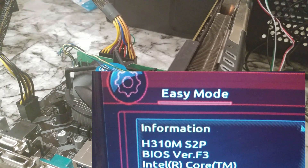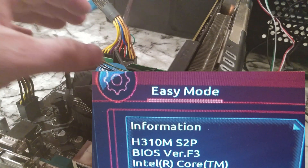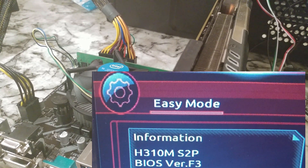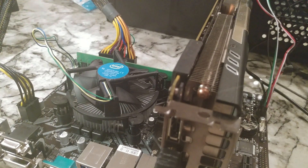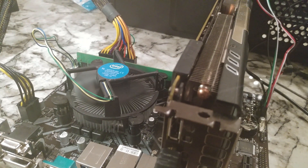I'm going to unplug the computer from the wall. I have a checklist out there that hopefully will help everybody troubleshoot these things, because there are all kinds of things that can go wrong when building these computers. Some things matter much more than others — obviously you've got to have working RAM in there, and for the F-type you've got to have a graphics card. Make sure all your other stuff is connected: HDMI cables, make sure you've got a good HDMI cable, make sure your monitor is hooked up. Check out my checklist — I'll have a link down below. So, firing in the hole — this is the i3-9100F in there.